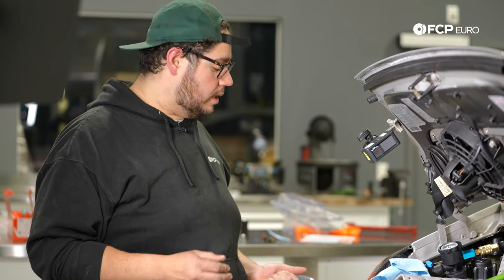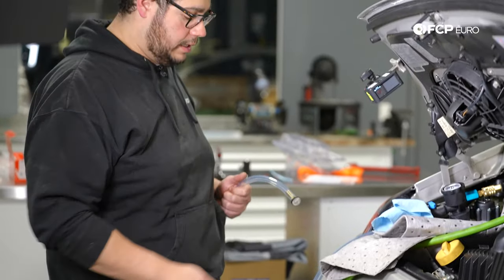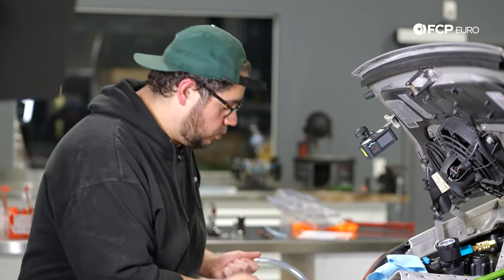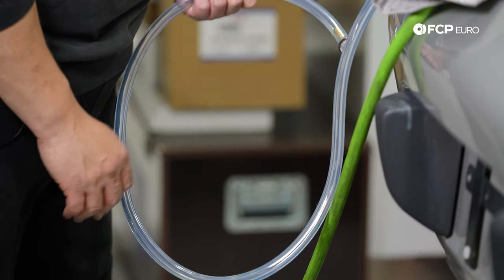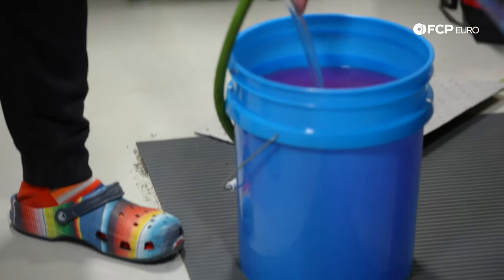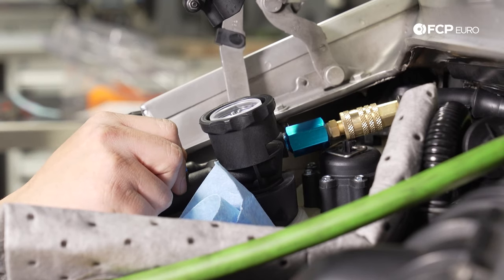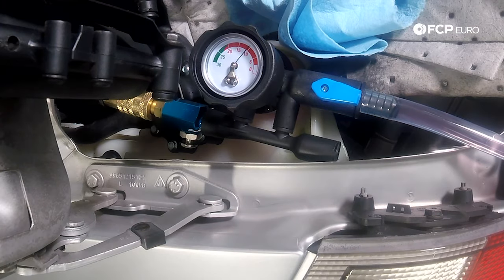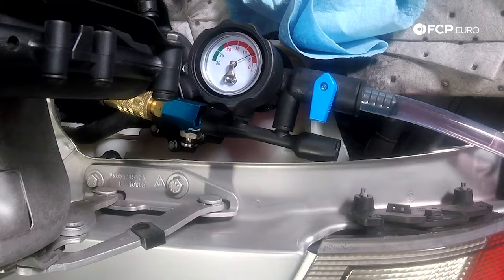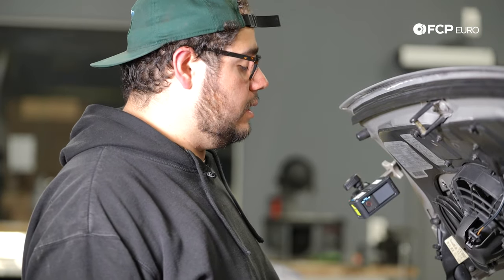Now that we've reached our full pressure and the system's holding, we're going to go ahead and dip our suction hose into our mix. We have a 50/50 mix of distilled water and genuine Porsche coolant — you can see it's totally the right color versus what came out of the car. Make sure your suction end is all the way at the bottom of the bucket at all times so you avoid pulling in any air. To fill the system, we simply release this blue valve and it should instantly pull up the coolant from the bucket. Pretty straightforward with this Air Lift 2 vacuum bleeder. Now I'm going to go ahead and remove this tool, put on our cap, and conclude this DIY.